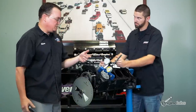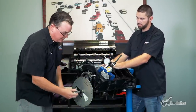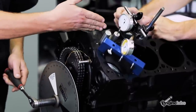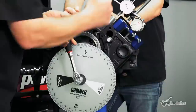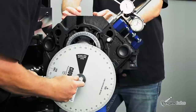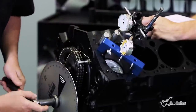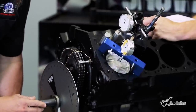What we're going to do first is take this and roll it over so the intake is at top dead center — we're going to set that to zero. Right now you're watching this dial indicator on the lifter? That's correct. You can see this is essentially the exhaust coming up right now, and then this would be your overlap, and now the intake is going to start coming up. As the intake comes up we're going to dial it around until we hit zero. Now we know we're at true top dead on that lobe. Now I'm going to back it back up to 100 thousandths down so that we degree this in the natural rotation of the engine.